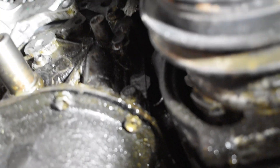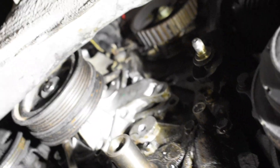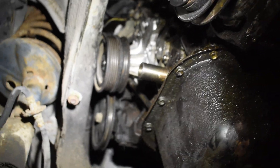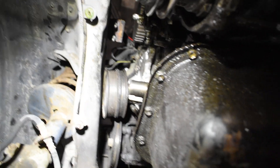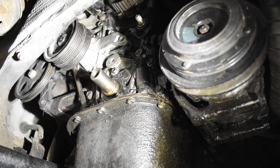With the engine completely loose on this side you'll have enough room to move the water pump in and out with the pulley detached, and I'll show you me doing that just to prove it's possible and the best angle to do it. You don't necessarily need a lift to do this — if you do it in your garage on jack stands, I recommend getting a floor jack below the oil pan so you can jack the engine back up so the mount is able to go up into the bolts to get them started on that motor mount, otherwise you'll be struggling trying to push the engine up.